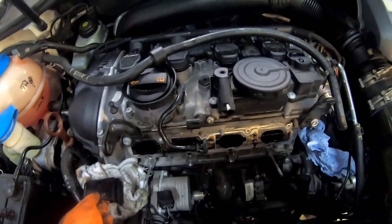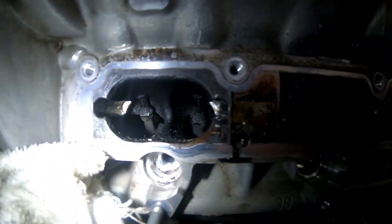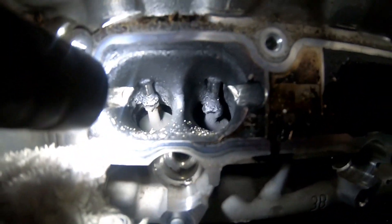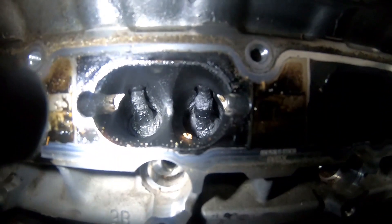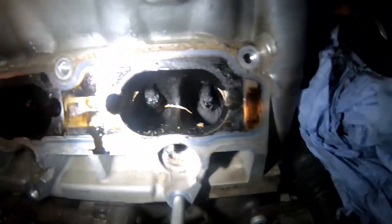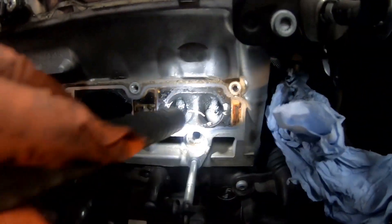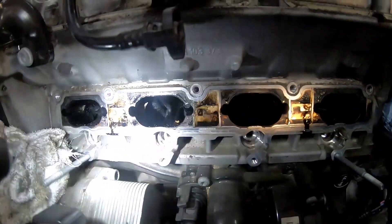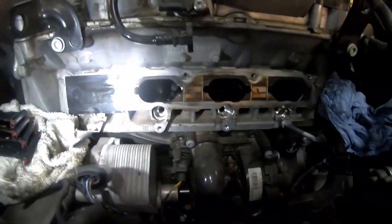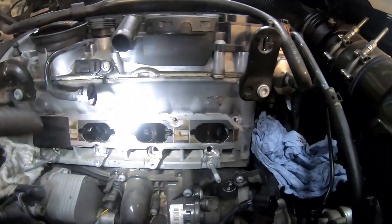The deflector plates just pull out. Some people delete these and tune them out with the swirl flaps, though that gives a bad idle from what I've heard. You can see how shrouded those valves are - they're completely wide open at the moment. You can see the complete difference between cylinder to cylinder; it's going to cause such an imbalance. So we'll rotate to get some valves closed, block off the ones that are open, and do a warm-up blast. We've got the open port blocked off with duct tape and paper towels in the injector holes. Then we'll blast into three cylinders.